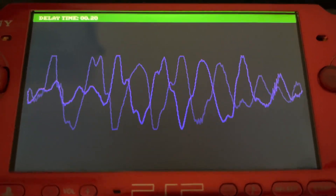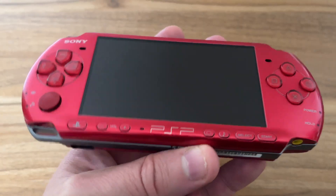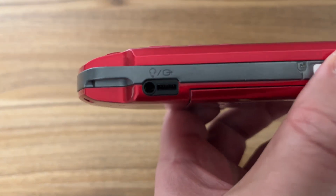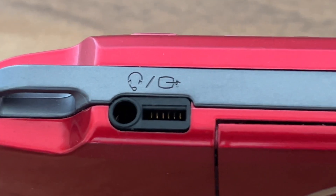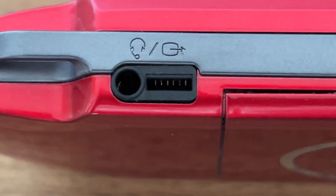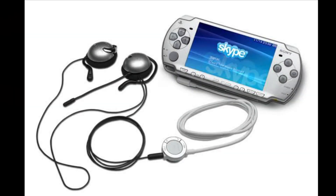This is what the clean or unaffected audio looks like. Even though this unique connector changed after the PSP model 1000 to accommodate video, it's always contained an audio input. When the PSP detects through its serial port that a headphone remote control has been plugged in, the audio input is enabled to accommodate a microphone headset.